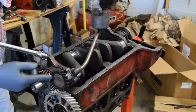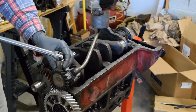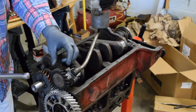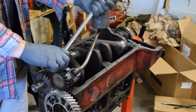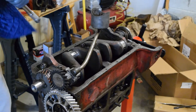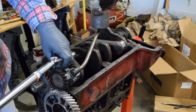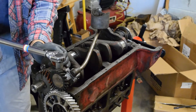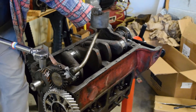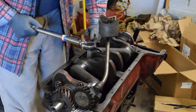We've installed the end here with the oil pump. There's no reason to time the gear for the oil pump — it doesn't matter. We are still going to take a picture of the timing of the main gear. We just got these barely tightened — not terribly tight. We'll call for 75 to 85 foot-pounds. We're going to start out at 45 just to start, then run them up. We're going to probably run these at 80. It makes a little clicking sound and you know what's happening — it's at the right torque.